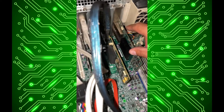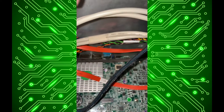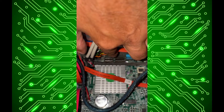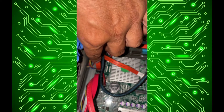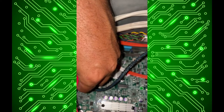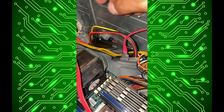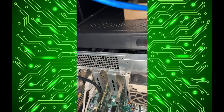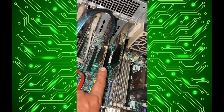We've got a 10 gig SFP+ dual SFP+ card here. The motherboard actually has SAS connectors down here but they're only 3 gigabits a second, and then it's got the regular SATA connectors — four of them are 3 gigabits a second and then two of them are 6 gigabits a second, which I'm using for my SSD cache drives. I also have a SAS expander card for the array which is 6 gigabits a second and I'm only using four ports on it because I only have four drives.